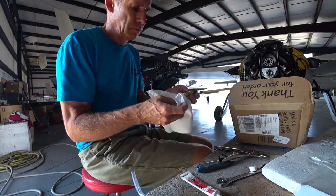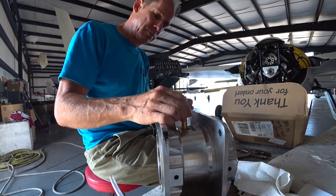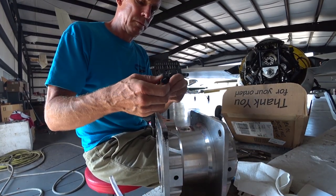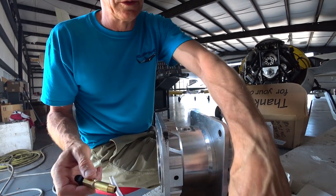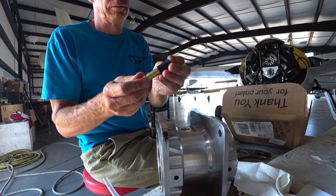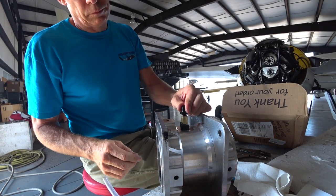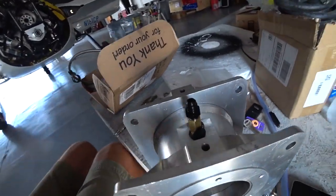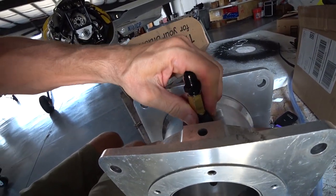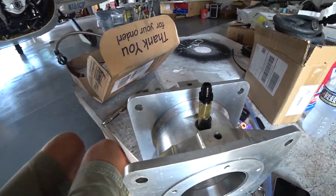As you can see, that'll sit in there and I'm going to put a little bit of rubber hose around there to hold it snug in that oversized hole that's already there. There's my little bit of rubber fuel hose — I put a cut in it so it stretches around the nipple, then that goes through the hole. I'll probably have to enlarge that hole a little bit; it has a thread in it right now but I won't need that. I'll wait until I've got the oil collar in with the prop shaft and see how much clearing I need to do.